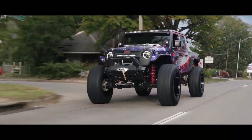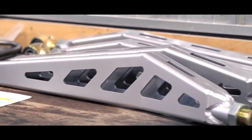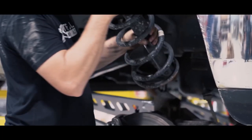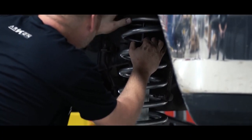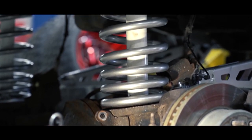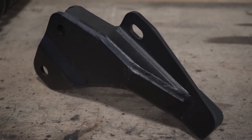Knowing these two aspects of how the front axle is centered — front to back and left to right — you always want to look for a lift that addresses these components. That means looking for things like new control arms or radius arms that will correct for the axle moving further away from the truck and centering it back up. Some kits will have brackets to move your stock arms, versus other kits that include completely new and longer arms. On top of that, a good lift kit will address the left-to-right centering of the axle by using either a track bar relocation bracket, which moves the track bar mounting location, or a kit that includes a new longer track bar that will re-center the axle.